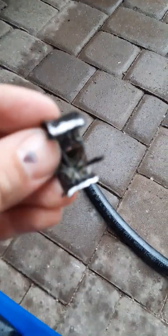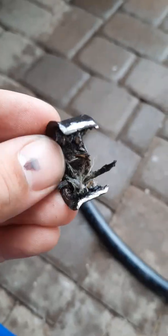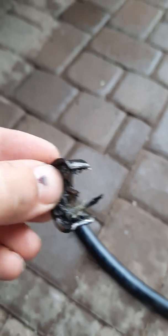These are the crimp fittings you have to cut. Here's an example: you cut a slit on each end, then use a flathead screwdriver to pry it off. This is the one by the transmission. Per the service bulletin, you want to replace the supply line and use two hose clamps per side.